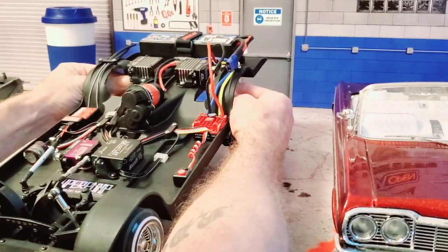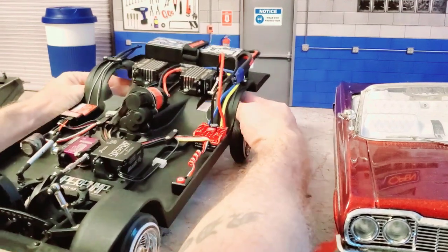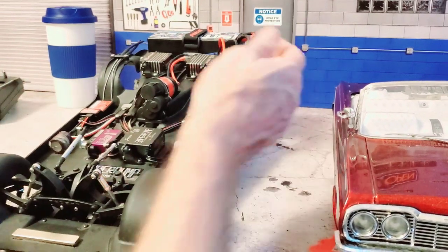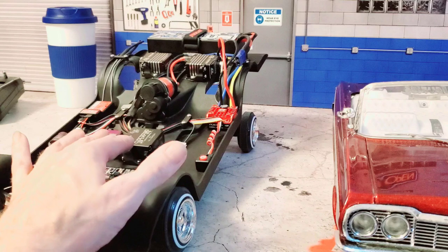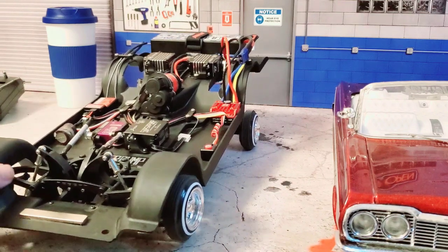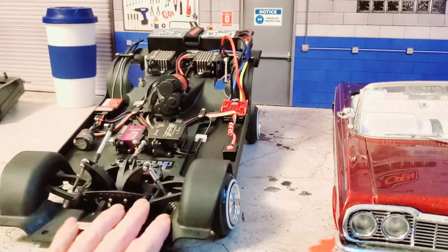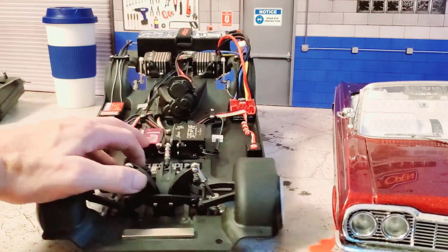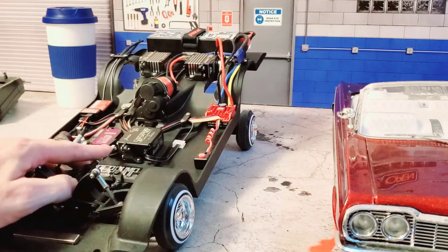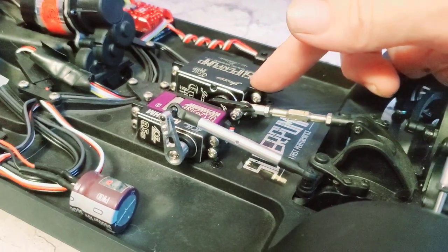With the Jevries Super Pump, as far as these lowrider RCs banging these hopping situations, the Super Pump is the fastest, strongest combination servo, which seems to be the ideal setup for these lowriders. So Super Pump with the short horn flip servo setup, giving the most snap off the pump. Gotta do the flip servo mod so that the gear is on the forward side.